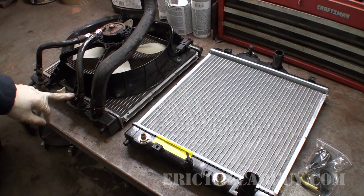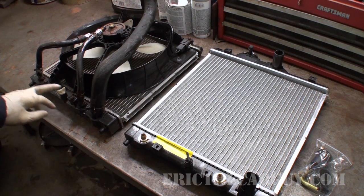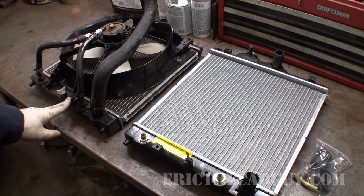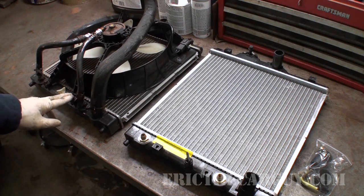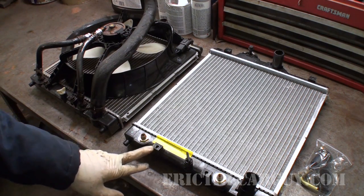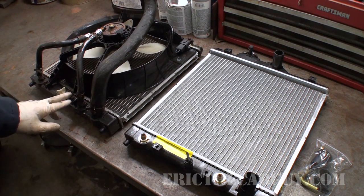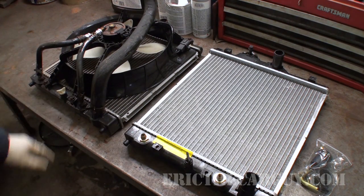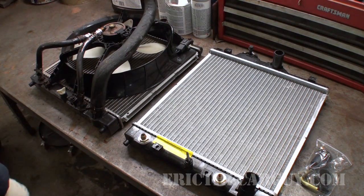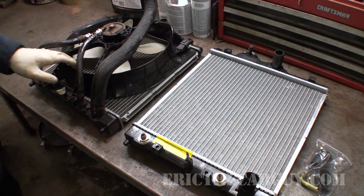There's some rust here, so I am going to employ a little bit of penetrating oil on the bottom of each of these fasteners. Now, if it doesn't work out — which sometimes it does not — that's okay. This comes with new nuts that go in here, so we just get new fasteners and go about our merry way. But if I can, I try to get the old fasteners out. Penetrating oil is our friend. I'll do the same to the top ones.